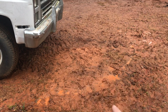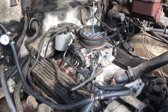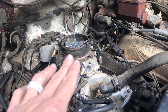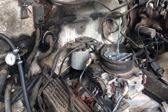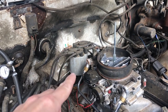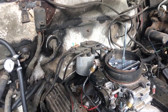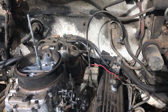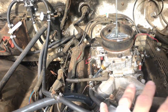This is what I get to stand in while I'm working on the dump truck — very muddy out here. Now this truck was originally a throttle body injection truck. The previous owner replaced the intake and added a carburetor where the TBI used to be. One thing they failed to do is replace the distributor. If you watch other videos, people always replace the factory computer-controlled distributor with an HEI distributor. That's what I'm going to try to do today. I don't even know that the computer is hooked up in this thing because there's so many things disconnected in here.